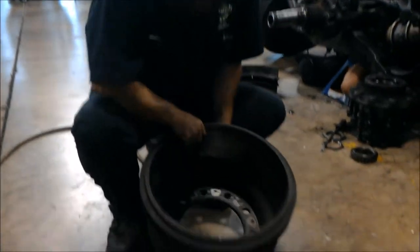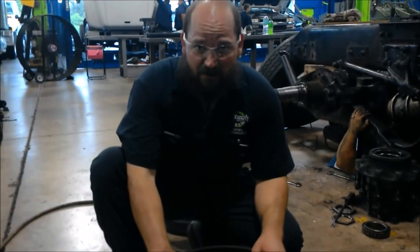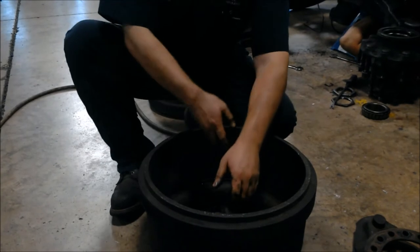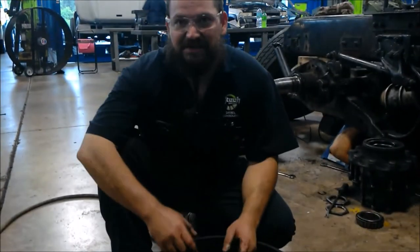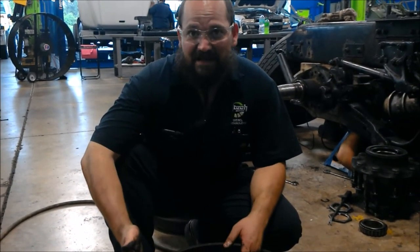While you have the brake drum, it's also a good thing to check for out-of-round. To measure in one direction, and then you can turn the calipers or measuring instrument to 90 degrees and measure across — they should be very close to each other so you're not out-of-round, because out-of-round can cause braking issues.